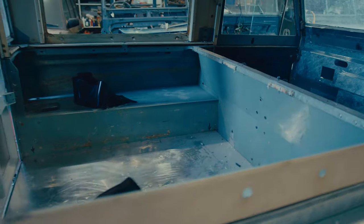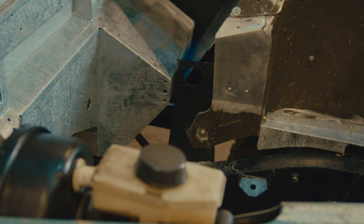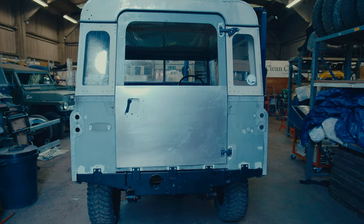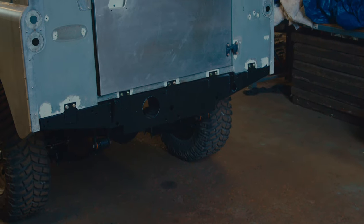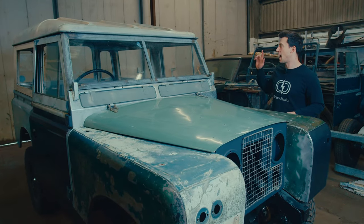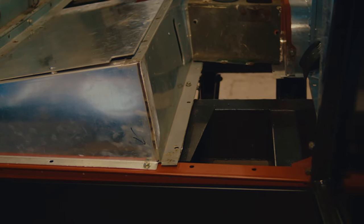Those who've seen previous videos will know we ended up replacing the bulkhead for a new galvanised bulkhead. We started the repair on the original, but as we blasted bits back we realised it was quite an undertaking, so given the project timeframe we went for a new galv one. We also reskinned the rear door that had a bunch of holes drilled in it — it was simple enough to replace the outer skin and it gave us the opportunity to ensure the door frame was sound. We've also replaced the rear tub floor and done substantial repairs to the seat box. There's been a lot of work to get to this point.